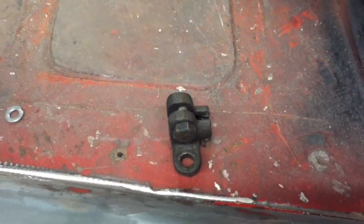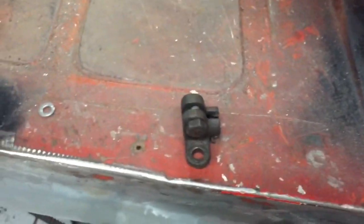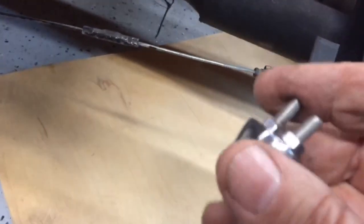I have to make a provision to mount this — this is the original cable sheath and clamp, and I've got to make a place to mount that. I'm going to try welding a slug on the end of the brake cable on both pieces so that when I attach them together with one of these cable clamps, it won't slip off. I noticed this was actually already a splice on the end of the cable — there was a little stub sticking out where it was cut off. This is a 5/16th diameter barrel on the end. I'm going to take the original cable off the truck and solder or weld on a little barrel similar to that for the splice connector.